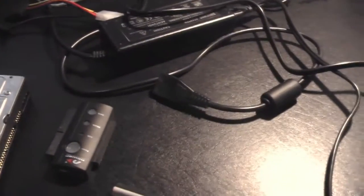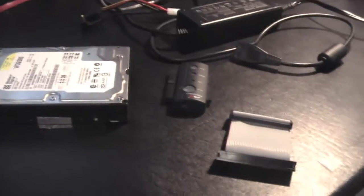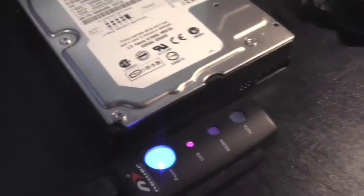I have all the contents of the universal drive adapter out. Hooking it up is really easy. First, I've got to give it power - plug the power into the wall. Second, I'm going to get my drive connected to the computer. This works with all kinds of different drives - SATA, and here I've got the IDE adapter. I'm going to plug this right into the back of my drive. Then I'm going to take the provided USB cable and plug this into the back of my computer. I've got to have enough USB slots, so I've got an extender thing right here. Now I've just got to supply power to the drive.